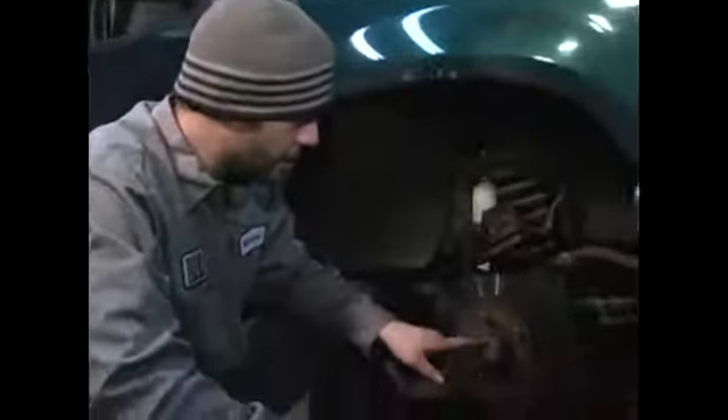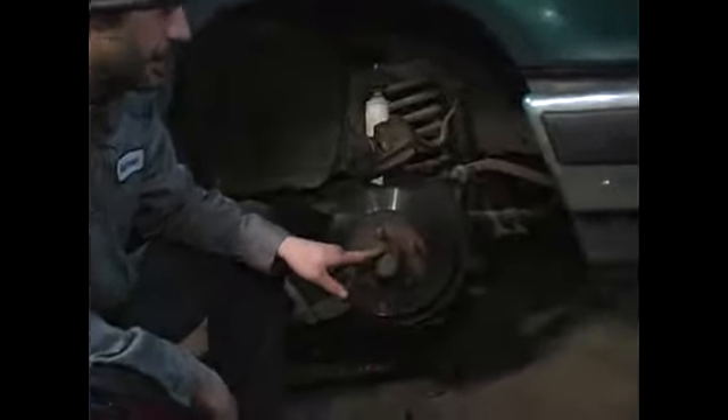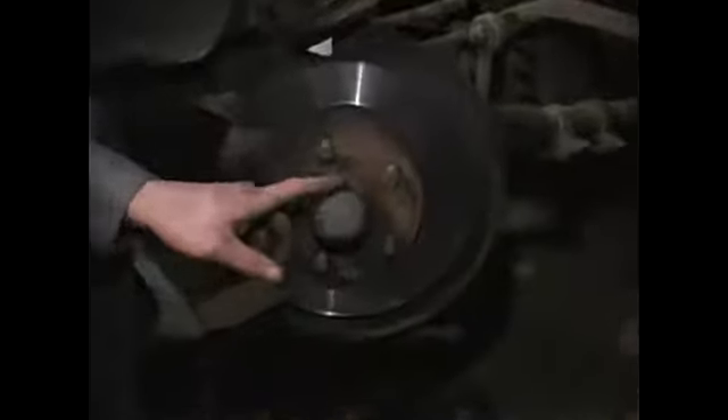In this clip, we're going to talk about the proper way to remove the vehicle's wheel bearing dust cap. The dust cap is this small stamped metal device right here. There have been a thousand and one tools designed for removal of this piece. I've tried them all, have purchased them all, and what I found has worked best is my trusty pair of channel locks.